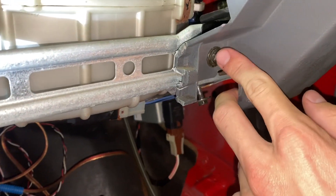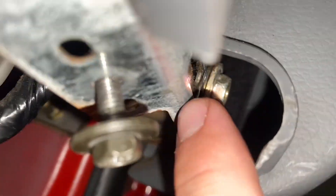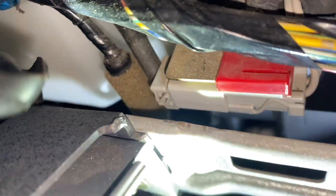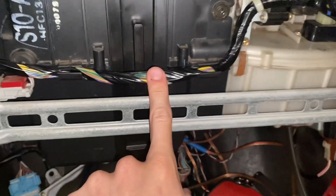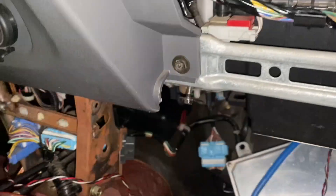From here, you're going to have that Phillips head right there and that one. You'll loosen those and you will see that 10 millimeter bolt right there as well as one right there. Above all else, I would recommend taking lots of photos before you start pulling this apart. I cleaned the filter about a week ago and I did not take photos before I started pulling this apart — the order of these brackets and everything — and it took me forever to put it back together.